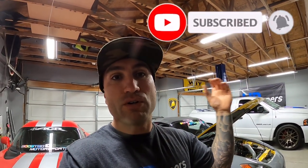That's it for today's video — that's how you change the oxygen sensors on a Dodge Dakota. It's probably the same for the Dodge Durango and the Ram 1500; they're all in kind of the same position. Depending on your exhaust they'll be a little bit forward or back, but in the general location. One tip: you could put anti-seize on the threads — usually new O2 sensors come with that already applied. If you found this helpful, give it a thumbs up, hit subscribe, and turn on the bell notification so you're notified of all the latest videos.